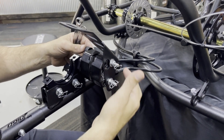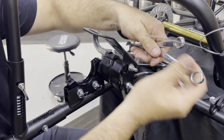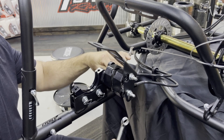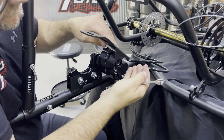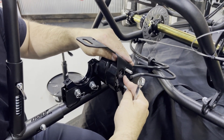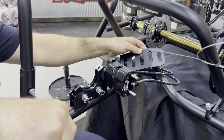We're going to install or de-install the brake caliper itself and show you how all these components go together. We always put safety pins in the end of these long brake caliper bolts, so I'll pull the safety pins out first, then loosen the nuts on these. I have both nuts off of these two bolts. There's a washer that goes under that nut on both sides. There's a wolf plate — this is a protective plate that blocks the rotor in case anything were to happen. That plate will just slide right off.